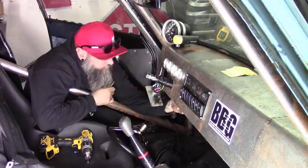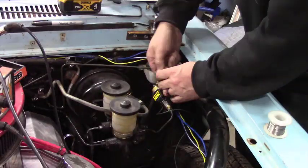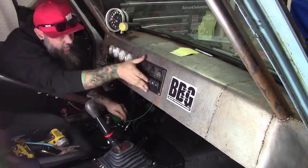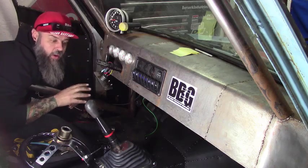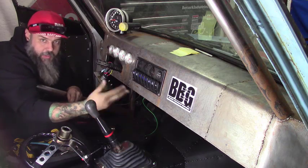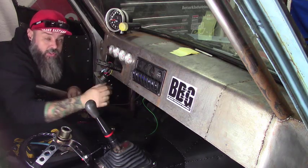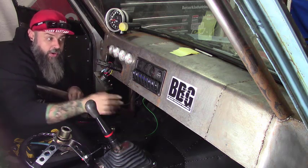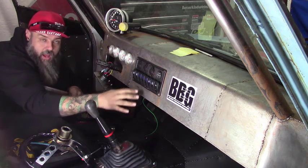They give you a fusible link and an indicator light, and you always want to fuse any power wires. When the button is pressed, it powers up the solenoid and the indicator light - pretty simple install. I'm doing mine a bit differently: instead of running that fuse block to the battery or an ignition-hot wire, I'm using one of my switches that's already fused. This gives me an on/off switch to energize the whole system - when I'm just driving around I leave it off, but when I'm ready to race, I flip it and my fuel pump, line lock, and everything comes alive.